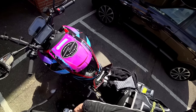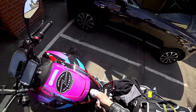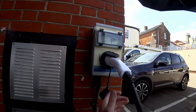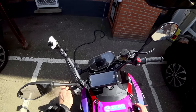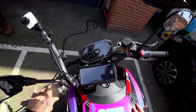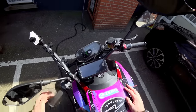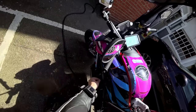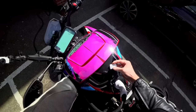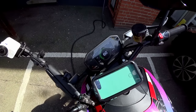Pop open the charging port on the bike — this is the only charging port on this bike, and you actually need an adapter to plug into a three-pin. We jam one end into the bike and smash the other end into this socket. We've got a blue light — that looks promising. Something's happening on screen — it says we are charging, steadily climbing: two kilowatts, 2.3, 2.7, 2.8. We're at pretty much full charging capacity for this bike. Interestingly, while it's charging, the USB sockets are also powered — so my camera batteries can be charging at the same time. It says one hour 35 minutes till full charge. Not too bad at all, considering we were roughly halfway empty.